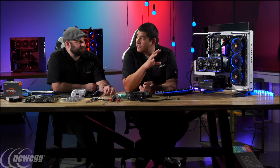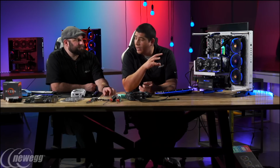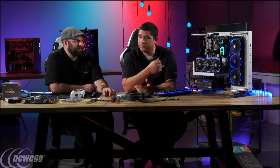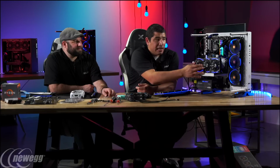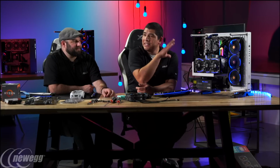Two, because it's a larger type of heat sink, I can displace more heat. I can keep those fans running at a lower RPM to keep it very quiet. Because right now, Greg, you're right here next to me. You can't almost even hear the system, right? Yeah. It's extremely quiet in that regard. You can see we've also got the 0 dB operating mode working for our graphics card. So it's a very, very quiet system. So I wanted acoustics. I wanted a lot of thermal headroom.